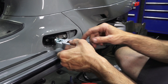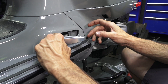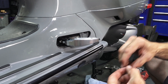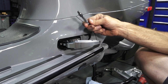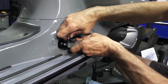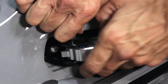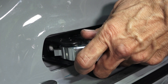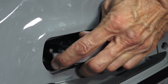We're not going to install the ball just yet. The easiest way to install the ball is to partly install the bracket with the spring cavity right over the hole for the pivot pin, then drop the ball into the spring cavity. Take a 4mm socket on an extension and press the ball in, because if you try any other way the ball just goes flying. Put a bunch of pressure with your socket and carefully slide the ball into place — looking from the top, be careful not to push the foot peg out or the ball will go flying across the room.